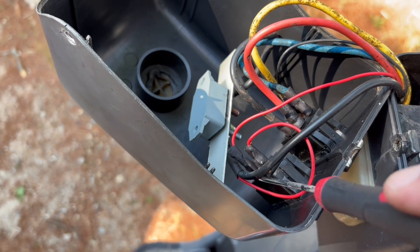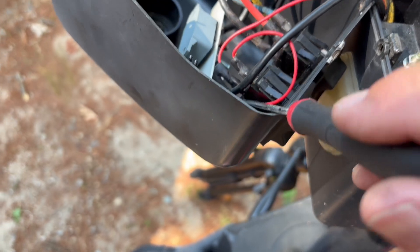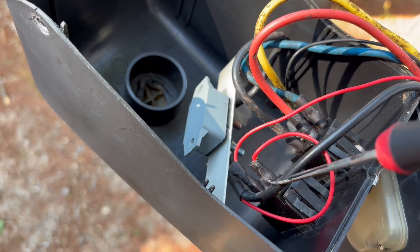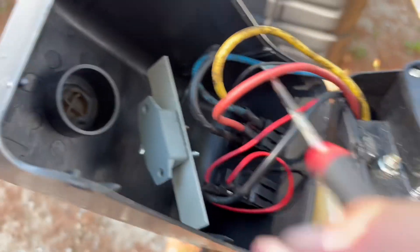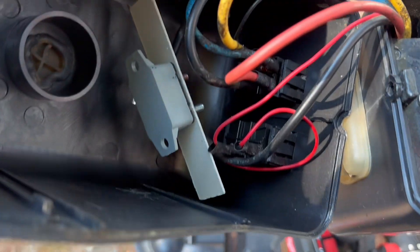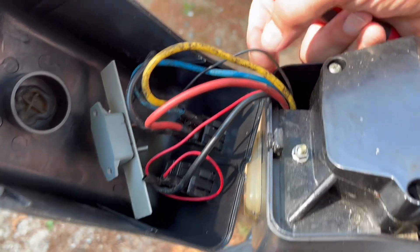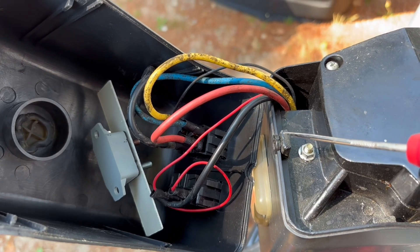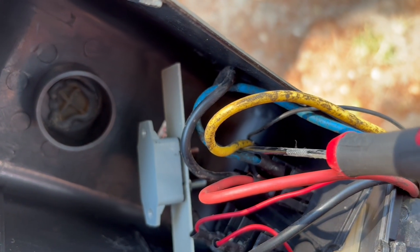This is my power line. There's a light on this jack, and this switch is for the light. It taps into this power line — power comes through this red wire down into the switch. When the switch is thrown to on, it comes up through the switch and down this red wire into the light. These little red wires are the positive 12 volts going into the light. I need a neutral to complete the circuit, and I find it on this little black wire attached to the jack control switch terminal.